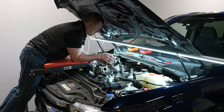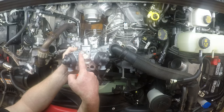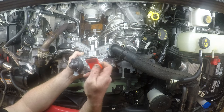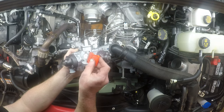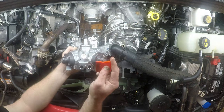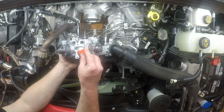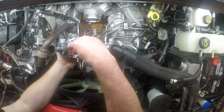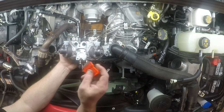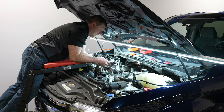On the topic of debris cleanliness: if you have debris on the face of the pump, after cleaning as best you can with the metering unit in using air and brake cleaner, once you have it out, put a rag down in the bore — the first one will likely get soaked with diesel fuel, so pull it out and put another one in. With the pump in the truck, take a razor blade or scraper, start at the middle, and scrape debris going away from the feed on the pump. Pull that debris away, then use a shop vac to remove it and to suck out your rag when complete.